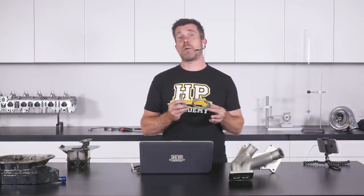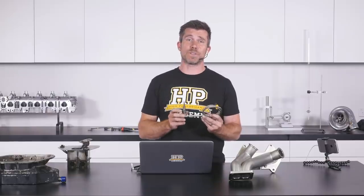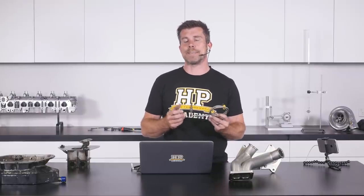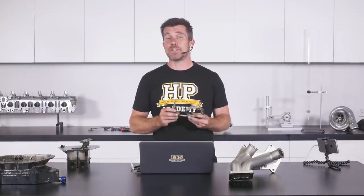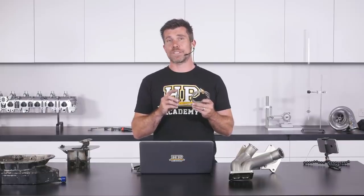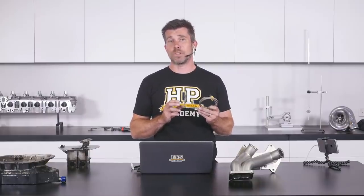These EGT sensors come in a variety of different designs — they come in eighth inch diameter as well as quarter inch. The one I've got here is a quarter inch. With an exposed tip, the advantage is that junction is exposed to the exhaust gas flow so it gives you a faster response in temperature measurement. However from my experience using these in harsh drag applications, they don't last that well, and when they do fail you'll likely end up getting a small piece of that junction go through your turbocharger. This is an enclosed tip where that junction is encased and protected. In my experience, enclosed tip sensors tend to read a little bit lower and also respond just a little bit more slowly.